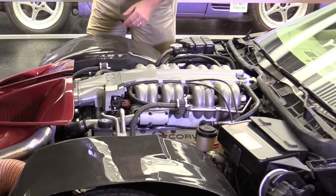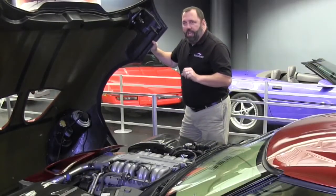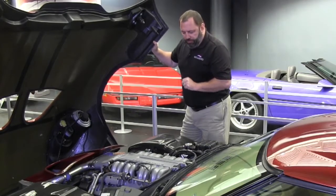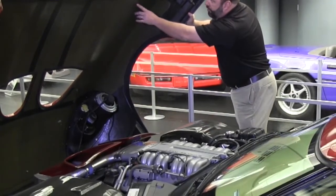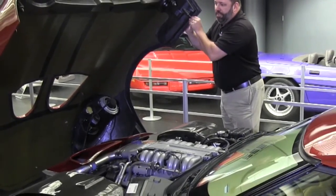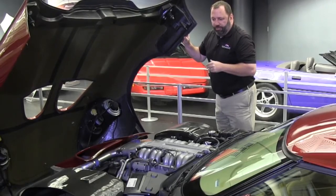This was the most powerful of the three twin turbo LT5 engines that we installed. There were a total of three twin turbo LT5s that Callaway built, one in a Callaway Corvette ZR1, and then the two Super Speedsters. I mentioned the use of carbon fiber. You can see the composite weave on the fenders, as well as under the hood. The entire skin is ultra lightweight. In fact, this hood only weighs a few pounds versus 60 to 80 pounds for a traditional hood, so exceptionally lightweight.